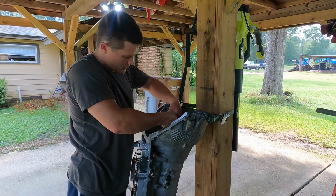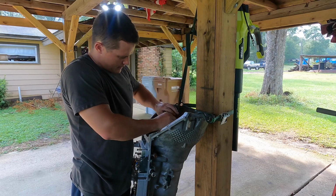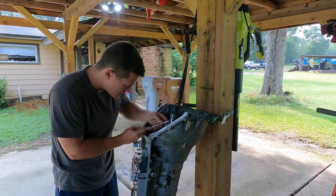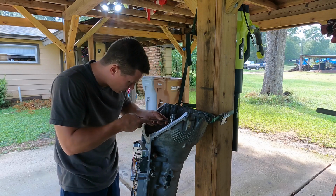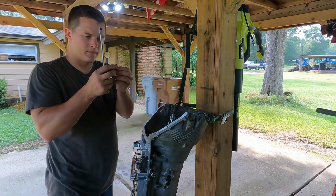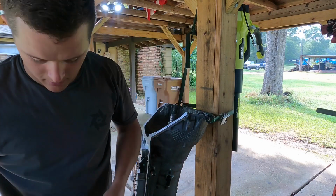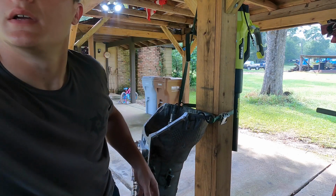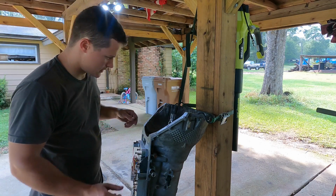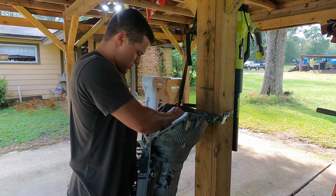All right, so I got the pump loose. It's about to come out. Just gonna try to take off this lockup O-ring here. Hopefully I don't tear it up. Yeah, crap. Put a pretty good tear in it, so that one's gonna be junk. But keep it, make sure to get the right size replacement. I think this is ready to come out now. Let's see what I got. Oh, I thought I had it loose. Hang on.